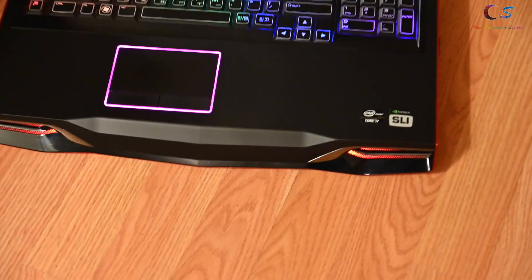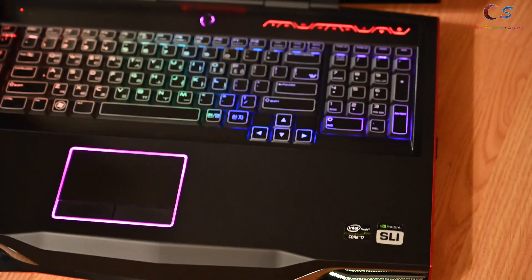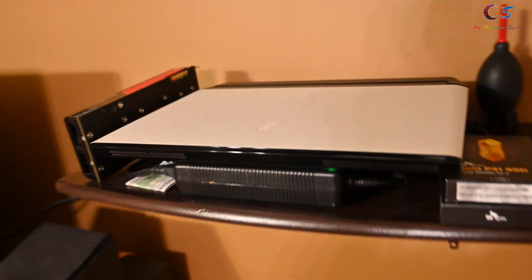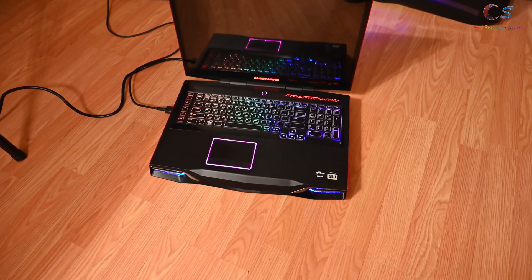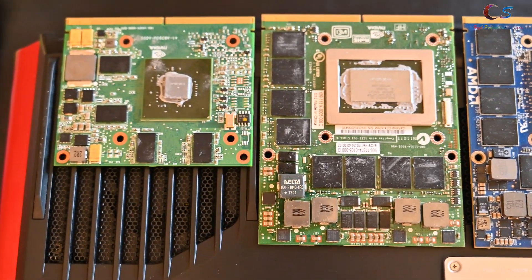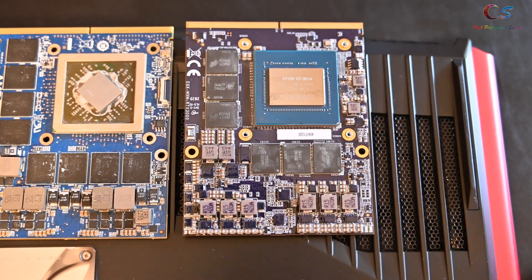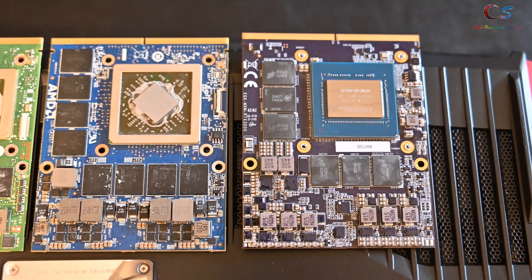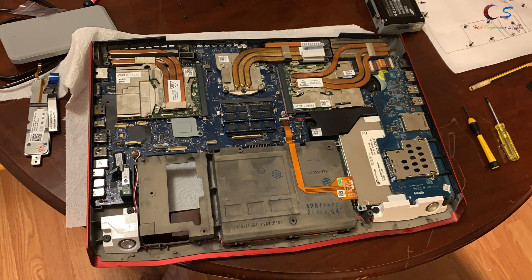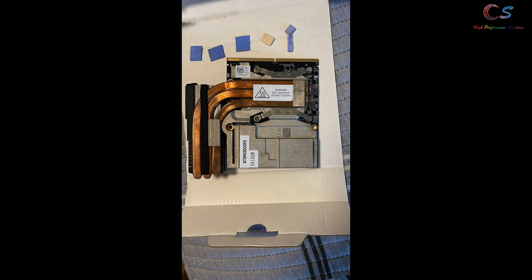The laptop we're upgrading today is the Alienware M18X R2. As you can see, it has an SLI sticker and an i7 Extreme CPU sticker, because this has dual GPUs and an i7 Extreme Quad Core. I do have its older brother, the Area 51M R1, but that one actually can't be upgraded as much as this one. Before we open up the laptop, let me close in on these MXM cards. The overall layout hasn't changed much at all over the years, and the new RTX 3000 looks like it'll work perfectly fine. The die size is a lot bigger, but that's not an issue since the heatsink's copper plate is big enough to cover the whole die. Here's a picture of my SLI setup — we're going to tear everything apart, and the important thing is to put thermopads on all the components and then put the heatsink on.